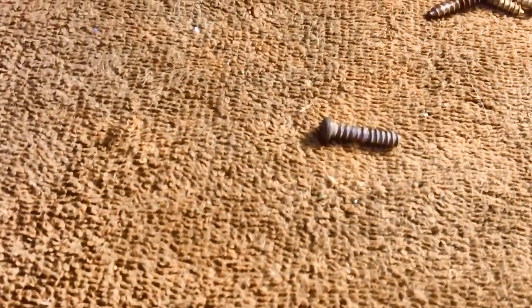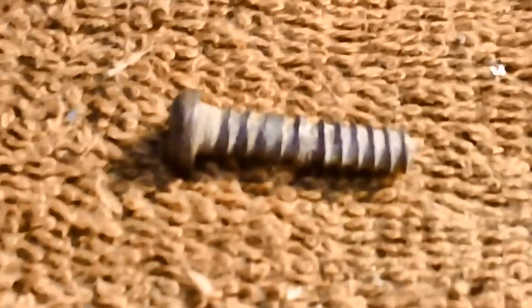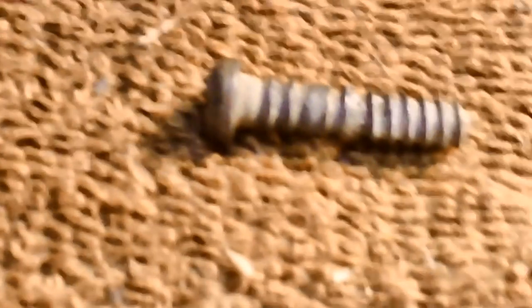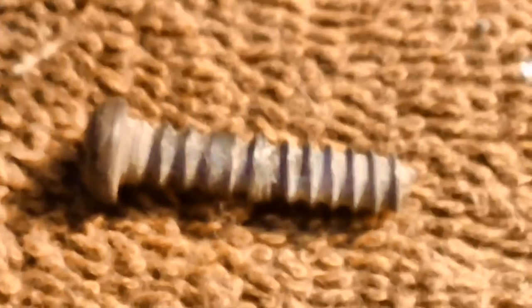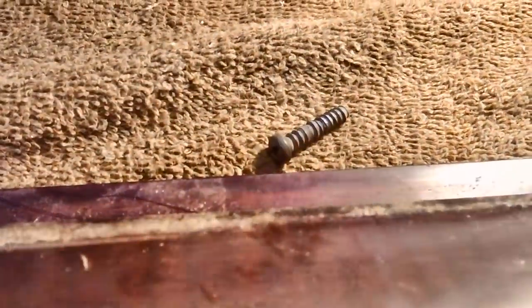And what I meant by a special type of screw, see that little wide thread right there in the center? I've got a pencil out here. The camera may not be showing that as well as it should. There's a wide thread right there by design. You know what that's for, to keep it from going in too deep. There's 16 of these around the outside of these plastic lenses, and it allows it to go in so far and then stop in that pot metal that holds all the lights. That keeps it from going in too tight and cracking the lens.